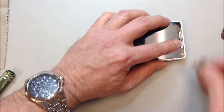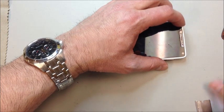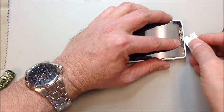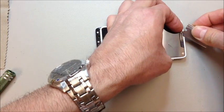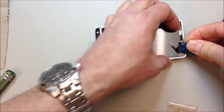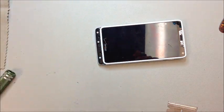You can see I went under there with the blade — try not to bend it. You can actually bend it back into shape once it bends, but if you put any crimps in it they're going to show up later and it's not going to look very nice. Use a liberal amount of heat and get right underneath the label. Try to peel it off in a smooth motion so that you don't bend it, and that'll expose the other two screws underneath.